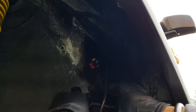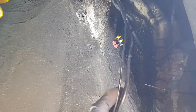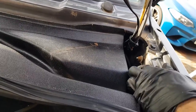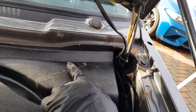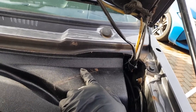Let's undo this plug. Just a couple of cables to undo and then it can completely come out. One is your earth cable and one is the actual aerial cable that goes to the head unit. I use this point here which is also used for the bonnet earth strap - as you can see mine's broken off - and the aerial cable goes off inside the car through the bulkhead, which I will show you later on.